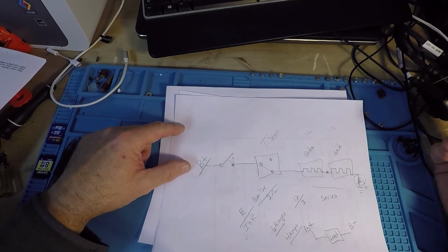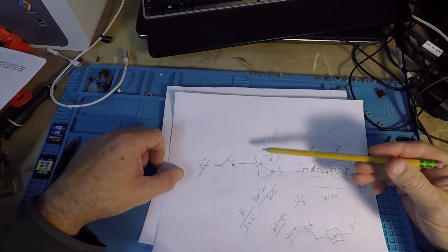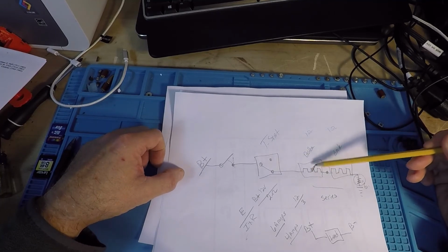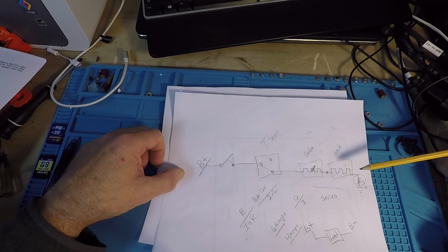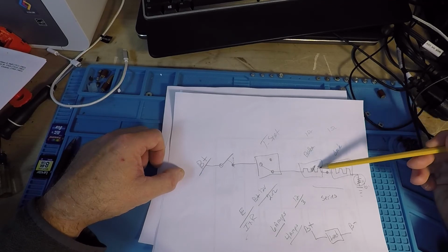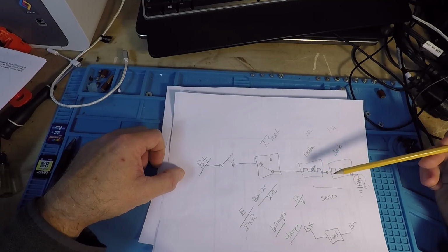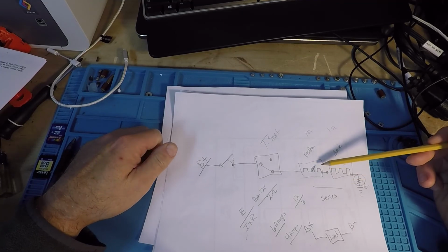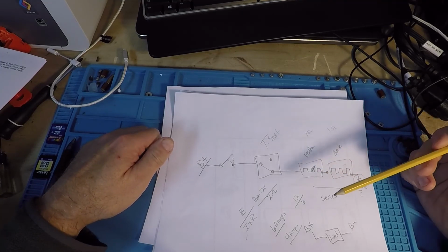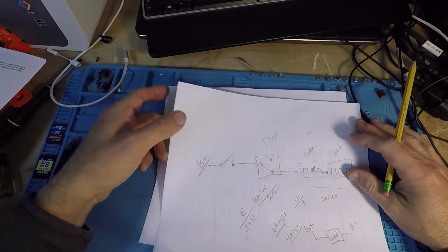So what I actually have is a break right there. So battery voltage is coming to the front seat heater. It is never getting to the seat back. So we're going to take a look at that and find out why. I'm betting that it's probably broken inside. It's a 97 vehicle. It's old. It's been sat in tens of thousands of times. So it's probably broken down. But we'll find out. Okay? Hopefully that makes some sense to you.